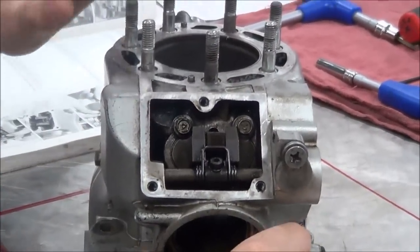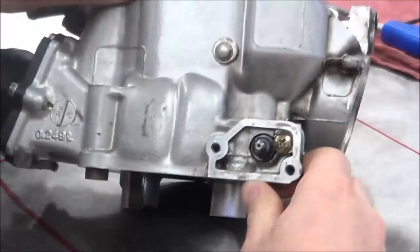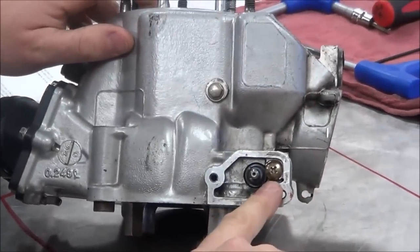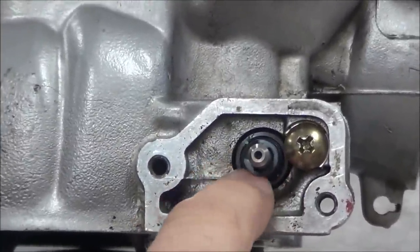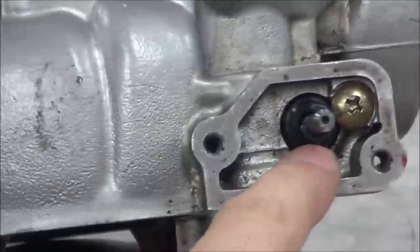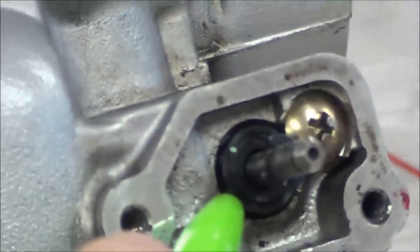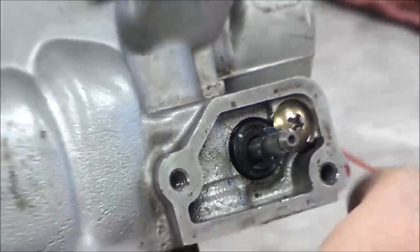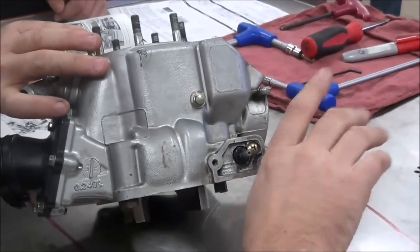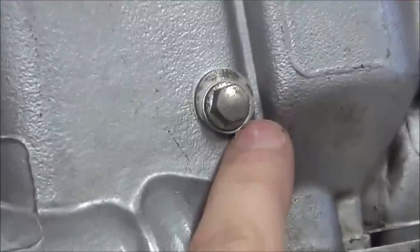It's a little more complex system with Kawasaki here. I don't see any more alignment marks right now, and I see here I have another type of retaining screw. It looks like I've got a seal that might not even be fully seated - it looks like it's above the surface here, so I want to pay attention to this. The other thing we're going to do is flip around to the bottom. Before I flip the cylinder, do you guys see this guy right here? Any idea what that is? There's a crush washer under it.